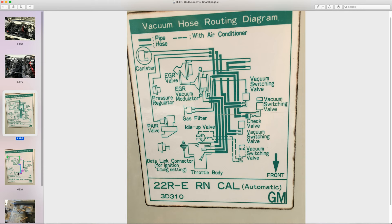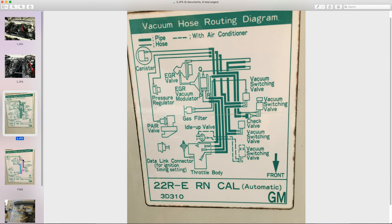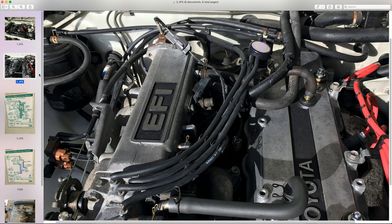That gives you a road map. You can knock a lot of this stuff off the list, especially if you're not running air conditioning or power steering, and simplify your life. If you're faced with reconnecting the hoses from this throttle body section, screenshot the little diagram: P goes to purge, E goes to the P port, R goes to R, and then the remaining port runs directly over to the vacuum switching valve for the EGR. I buy a 50-foot spool of Gates four millimeter hose off Amazon — you can thread it through, cut it, and trim it exactly to size and it turns out real nice.